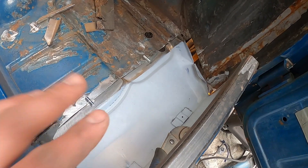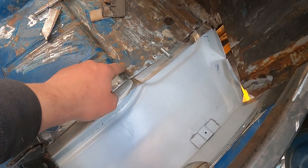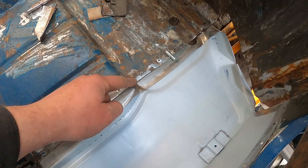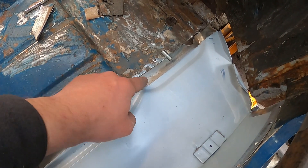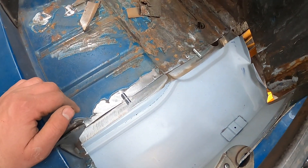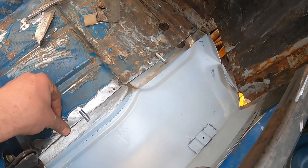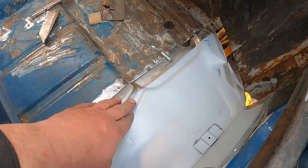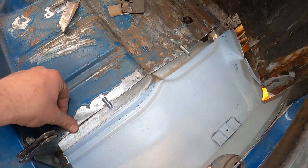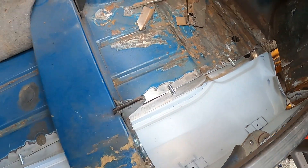So we'll do all those little repairs at the front. I didn't want to have to cut the flitch out, being quite frank. The profile around here on the floor — it's worth noting this is an after-market machine panel — isn't the best. So what I've done is I've slit the floor, and I'm going to hammer it, weld it, hammer it, weld it, and try and get that look in as factory-nice as possible. I know this is a repair job, but I want it to look as nice as it possibly can for Pete. It's a really original car. I know it's not an original repair, but when you pull up the carpet, I want it to look nice. I'll grind it all back and make it look really nice.